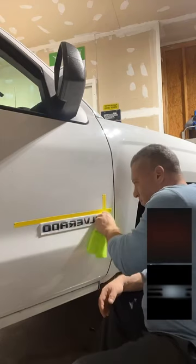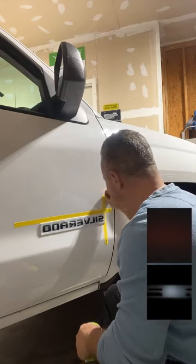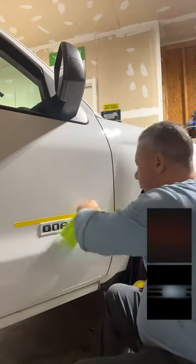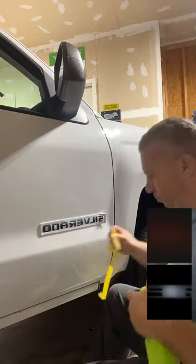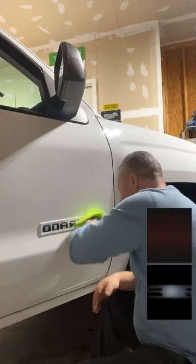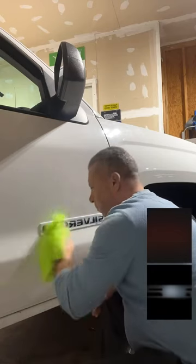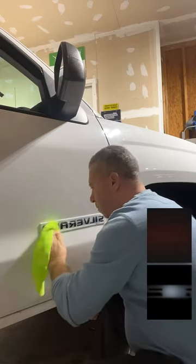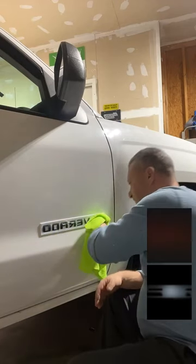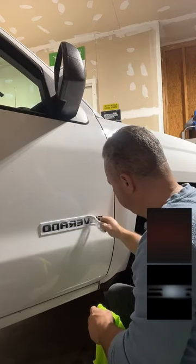I have five or six cleaners that I use on the interior of a vehicle. If it's a very, very light dusting, I literally will use an interior detailer and wipe. I don't need to clean it. If it's not dirty, it doesn't need to be cleaned. So there are cars that I get that literally just need a wipe down. Why are you using a very, very caustic chemical to clean something that doesn't require it? And that's one of the things that I try to explain to people, that we need to be doing as little of that as possible.